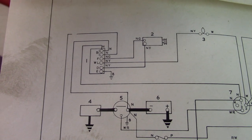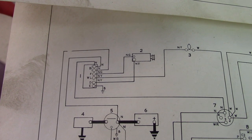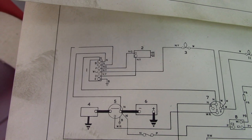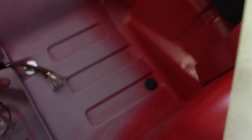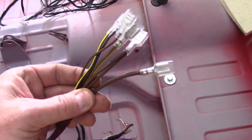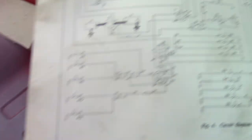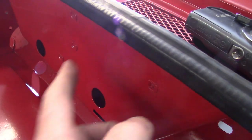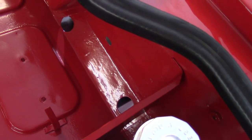This box right here — that's the control box. It's essentially the voltage regulator, but back in the day it was an electromechanical thing — pretty big antique, pretty cool though. This stack of wires, a bunch of browns — you can see some of these are pretty heavy gauge — those all go to that control box. I know from memory those are what come through that hole here, because the control box screws into the firewall right here. So that'll be the first portion I route: getting those wires up through there.